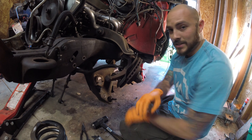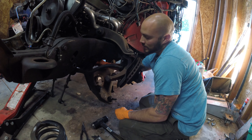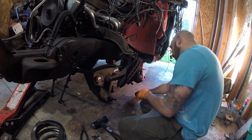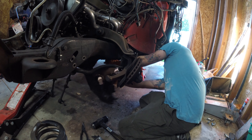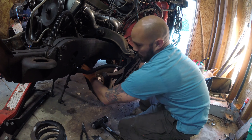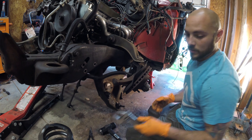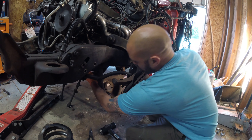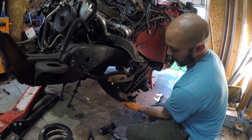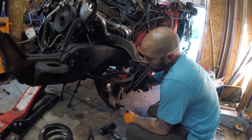So I've been putting this off a while because I didn't want to have to go through all this work. I was making it to be a bigger job than it is, I guess because I didn't know 100% what I needed to do. So I made it a big deal, but it's really not. So with these bolts, you don't want to put them on all the way tight. I'm going to tighten them down, not torque them, just so they're snug. But if you tighten them too much, you won't get this play, and we need that play to jack it up with the spring.